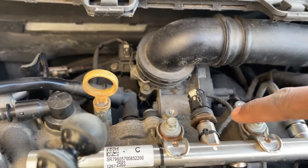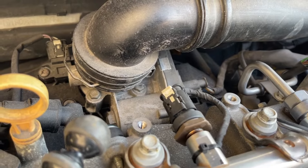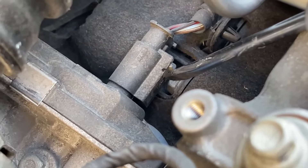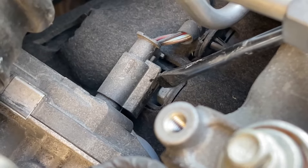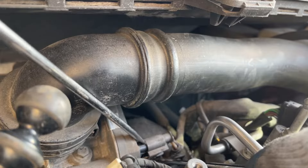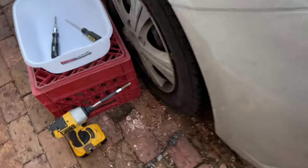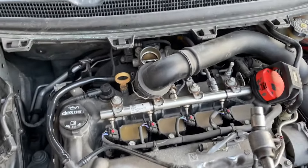We're going to push that back and undo this. There's another safety clip. We can pull this back out of our way and get those four 10mm screws. Let's remove this throttle body — I'm losing light. Using a swivel 10mm with my impact, pulling the duct back.